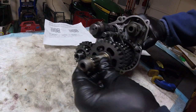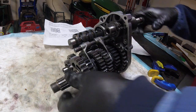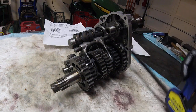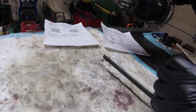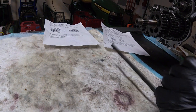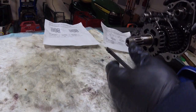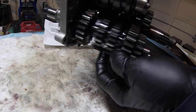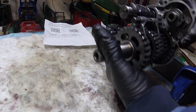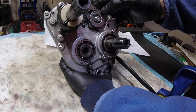The great thing is everything is in very good condition — all the gears, shafts, bearings, and the casing looks great. I'm going to mock this up by using a shaft to hold that third set of gears in place, stopping them from sliding backwards and forwards, so we can actually demonstrate the selector mechanism.